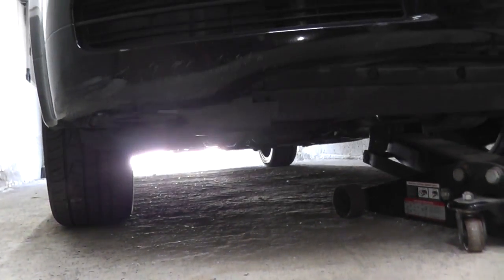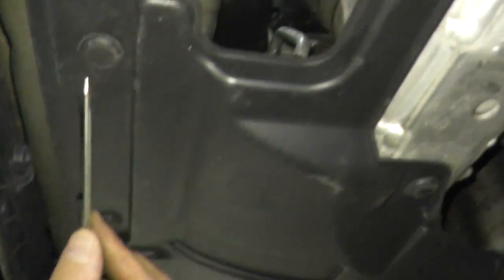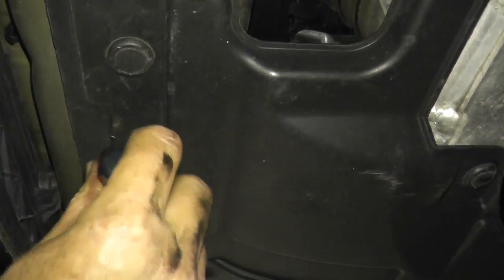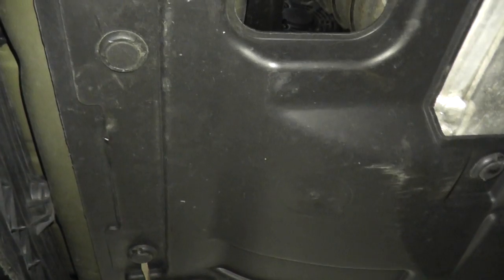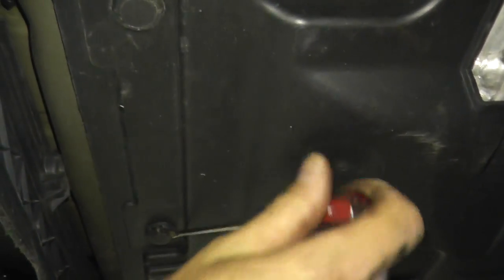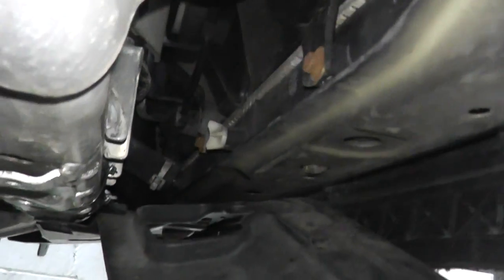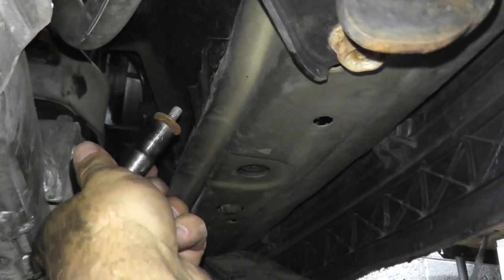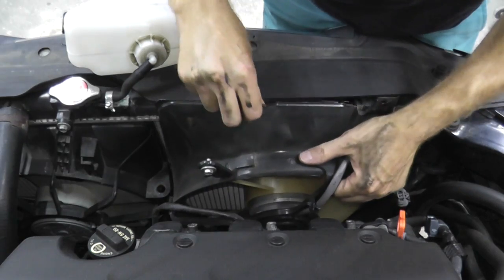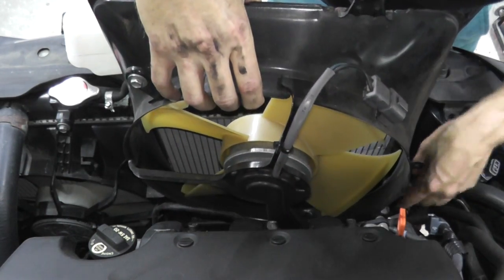There is a bottom fastener holding on that shroud, so we're quickly jacking up the vehicle. Of course, don't forget your jack stands. If you still have the wind deflector installed on your vehicle, it's pretty easy to remove — it just has a number of plastic tabs. You can actually purchase a tool to remove these, but if you're delicate and careful enough, you can do it at home with just a flathead screwdriver. I'll have a link for replacements below.